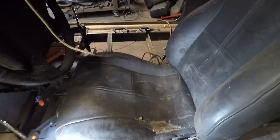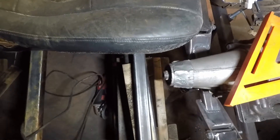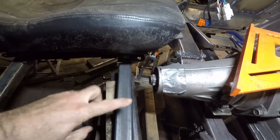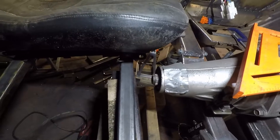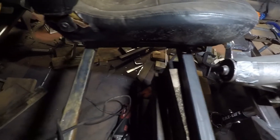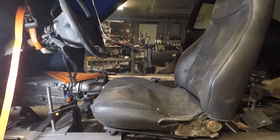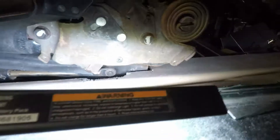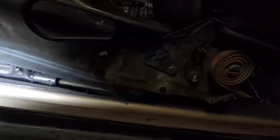This is the view from the passenger side of the driver's seat. I think we'll have enough room for the transmission tunnel — build that up around here. Got enough room to get the transmission out. I think I'll build a brace that goes up like this, with some structure to mount the floor pans to. Now the seat is sitting flat and not rocking on the brace. We'll relieve that a little bit more and it's ready to start drilling some holes.